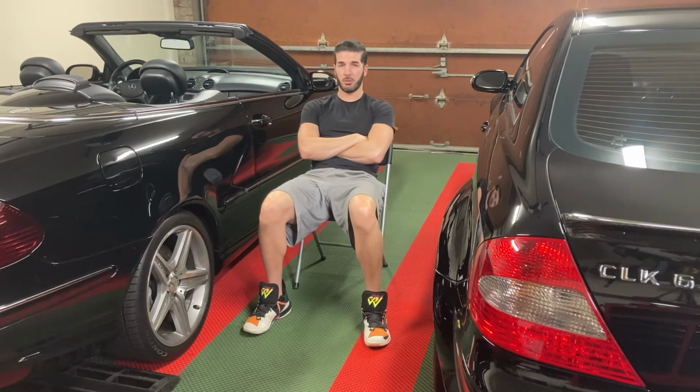So even if you do the rear subframe for the SL600 or whatever you want to put in there, sure, that'll hold up, but too much chassis flex. Unless you're putting an integrated cage in there or doing something like that, you're going too far. It's not about horsepower. Unless you're keeping a 4-cylinder with mad crazy turbo and boost and EFI and things of that nature, like they did in an actual DTM, you're going to be disappointed when you put that motor in there.